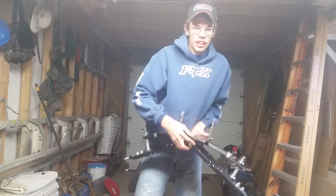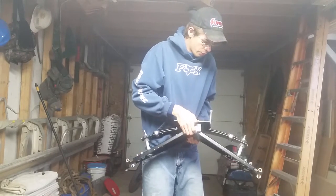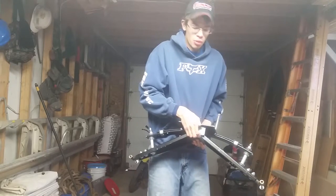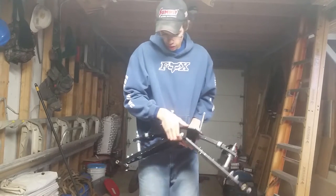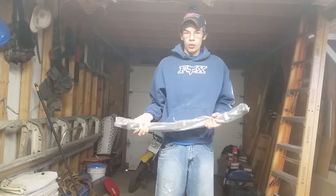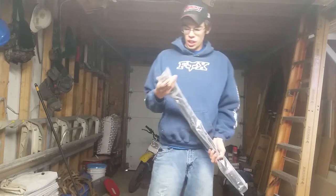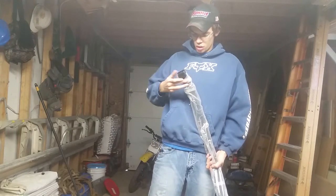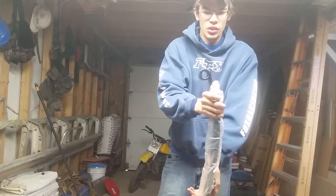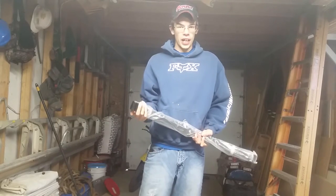Here we have the lift kit itself — pretty heavy, I must say. All these lift kits are pretty much the same for the double A-arm lift kit. You've got some heavy-duty springs included in the kit. Some kits come with them, some don't — make sure you check that if you're going to buy one of these. The bushings go on the inside of the eyelet hole but they come in the pack, so you have to manually put those in.